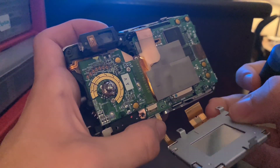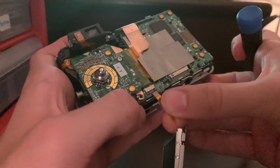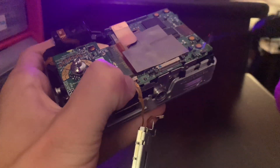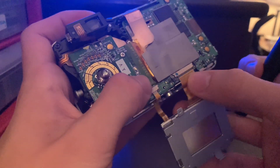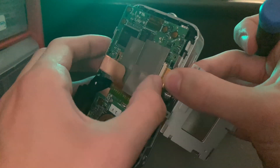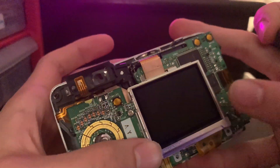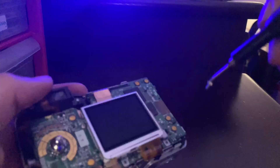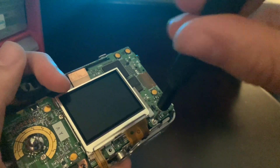Taking the ribbon cables and putting them back into place — I did put them in the wrong spot, but they go on the top of the plastic part there. Pushing that back in sticks them in and makes sure they don't fall out. If you already use this camera on a day-to-day basis, heavy usage wouldn't knock those loose. Connect that little liner thing on the top, then screw in the screws that hold down the LCD so that it does not move.